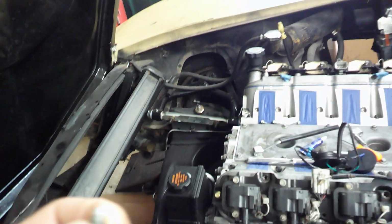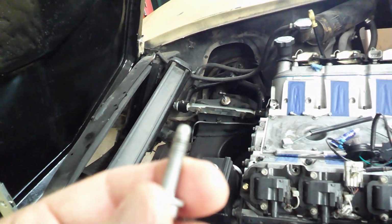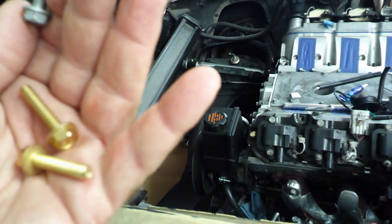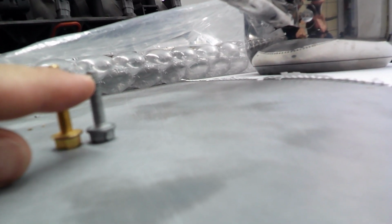So I got a tap. I'm going to go ahead and tap down into that hole that I felt like it stripped a little bit. It should be okay because this bolt's a little bit longer, so I'll show you the difference actually. It's quite a bit longer, especially when you consider that the last quarter inch or so of this is not really threaded. Really, honestly, the last quarter inch even with the thread start is tapered, so it's quite a bit longer, so these should be perfect.